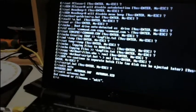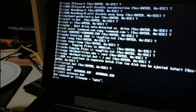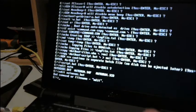All right, so it does a lot of stuff. Why does it want to do this? It looks like it's doing junk. You know what? I actually have the autorun file. Let's manually run the autoexec. Preview with Notepad. It's setting the RAM disk to N. I don't want that. Okay, so NetBoot get drive. I don't know why it thinks there's NetBoot.